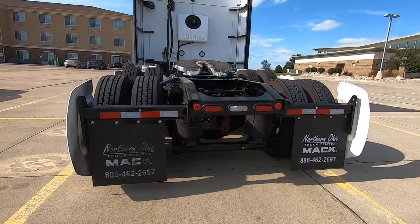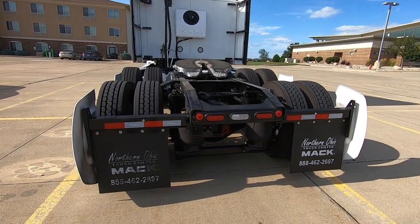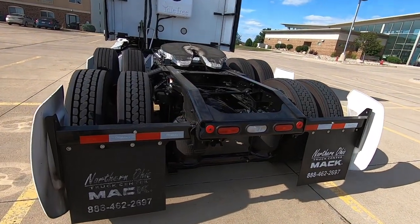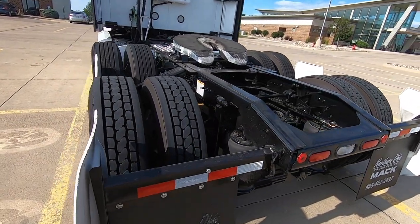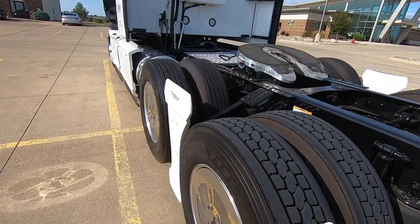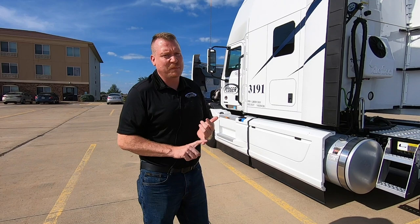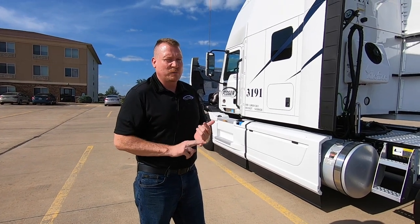This is a down-sped powertrain. It is a 2-4-7 gear ratio in the drive axle, and it's a 13-speed M-Drive heavy-duty, which is a .78 overdrive — so 72 mph at 1200 RPM. I also have the ability to run in direct drive at 55 mph, 1150 RPM, which is kind of the magic spot for fuel economy in these trucks. I call that the 2-speed cruise concept.